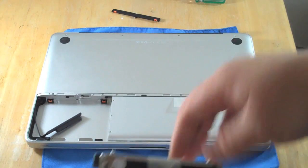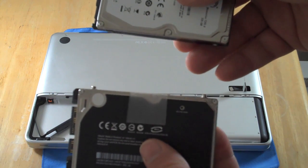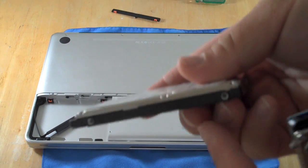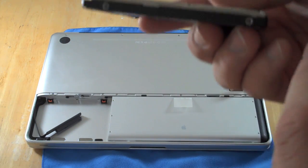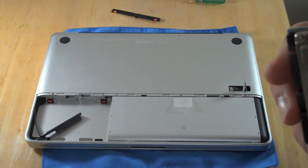Here's the old hard drive. If you want to look at the differences — this is a faster hard drive, 7200 RPM, double the space. And you have these little pins on the old one, and on this new one you don't. So you're going to have to take these off and place them in here, and then you'll be good to go.